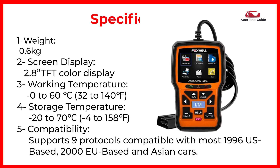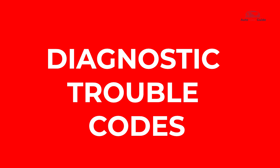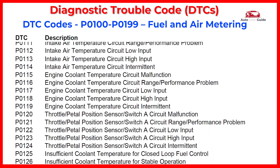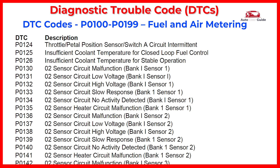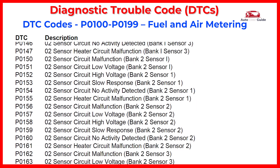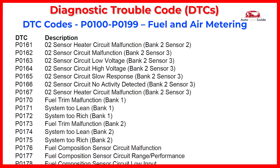Specifications — Onboard Diagnostic Trouble Codes: this list contains standard diagnostic trouble codes (DTCs) used by some manufacturers to identify vehicle problems. DTCs are how OBD-II identifies and communicates to technicians where and what onboard problems exist. The first number in the DTC indicates whether the code is an SAE generic code (applies to all OBD-II systems) or is specific to the vehicle manufacturer. The remaining three numbers provide information regarding the specific vehicle system and circuit.